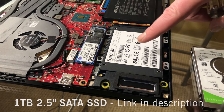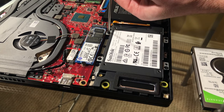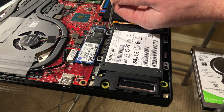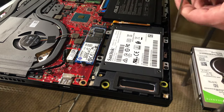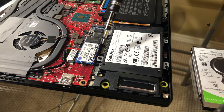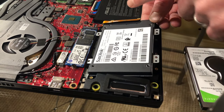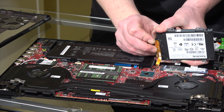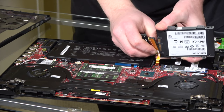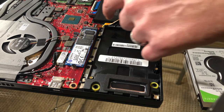Next we have the hard disk drive. This is an SSD that I've swapped in — I'm going to take it out and put the stock one back in just so you can see how the whole process works. These are just regular Phillips screws with a pretty small tip, so be careful with these. You really don't want to mess up the holes or the screws or your tray. Now that the screws are disconnected you can just pop the hard drive up and it's connected with this cable along the back. That's a very sturdy connector but it pulls straight off — be careful though, you don't want to damage that thin cable.